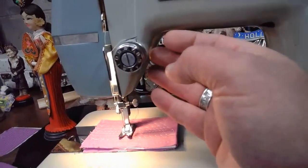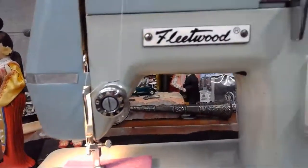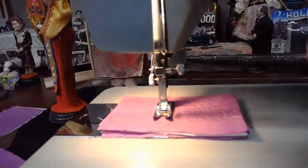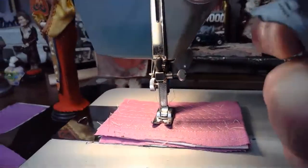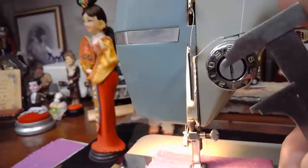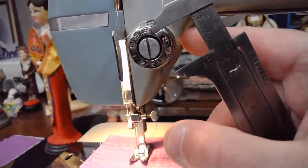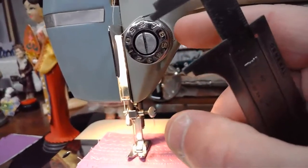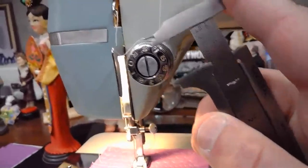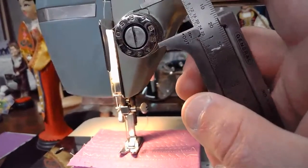And most of the Japanese machines are going to be pretty common as far as the size of that opening. Most of them are going to be, I'll kind of show you, right around in the 15 to 17 size range. And then again, when you're sliding that little inner core in, it's going to slide into the machine, and then you're going to anchor it into place, and then you're going to mount the rest of the components of the upper tension in place. The problem with this particular Fleetwood from 1957 is that instead of having a more common opening like this, it has an opening